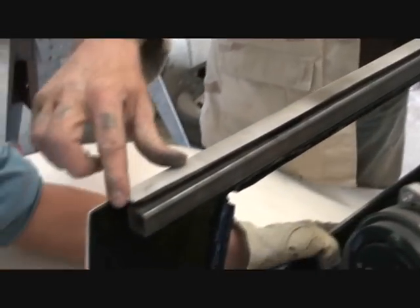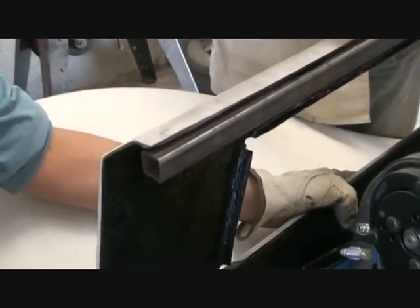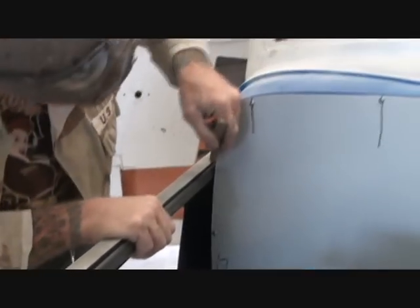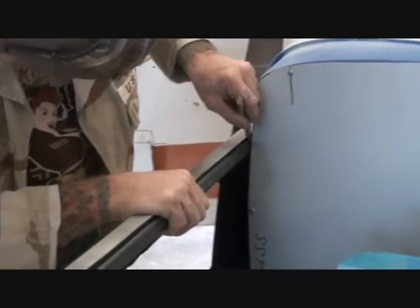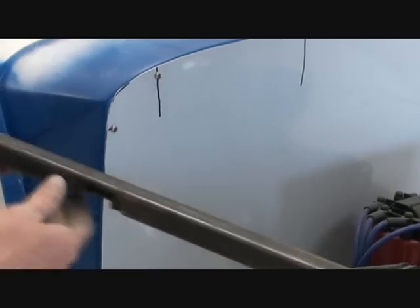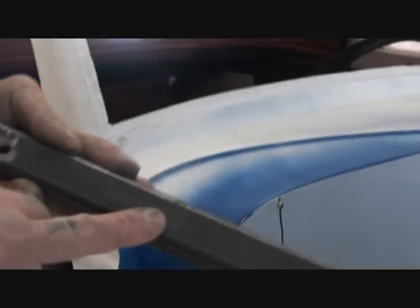On the line that you made earlier, I'm going to slide my rod inside the hole just like that. It should line up pretty close to the end of this notch here — that will give you a good lead point where to stop. Now I'm going to eyeball the top of my rod — my square tubing — with the firewall, and I'm going to make an arrow right there. I'm also going to scribe the back side. The thing you want to do is line the marks up that you have. If you look real close, you can see the mark that I scribed on here.